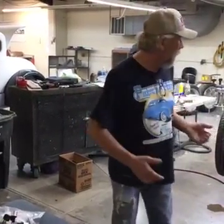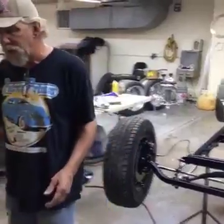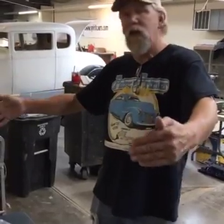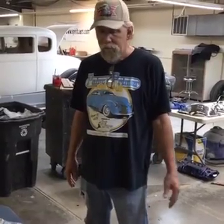I like to split my headlights. So rather than run both wires down one side and come across for the headlights, I'll go ahead and split my headlights right here. So I come across and I run one left side down the left side and right side down the right side. If we're going to have turn signals, think about that. If you're going to have turn signals and running lights, a lot of times we'll just do turn signals on a T-bucket.